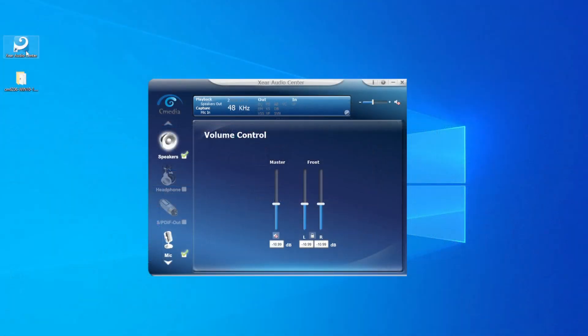I had a trick up my sleeve: I know that for this device there are drivers from C-Media themselves. So I installed those drivers. In the driver interface — one we've seen many times across many other devices — if you want to set it to headphones, you need to know a specific trick, and that's one of the major downsides. There's no jack sensing and no button to switch between front speakers and headphones, so you will always need to install the drivers.